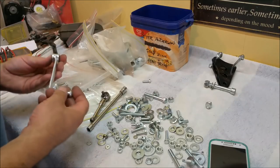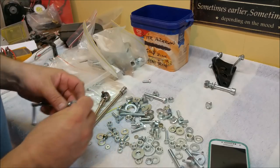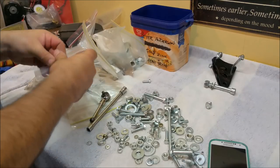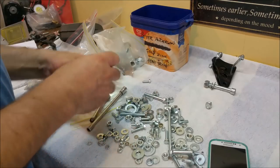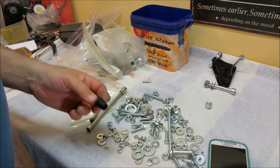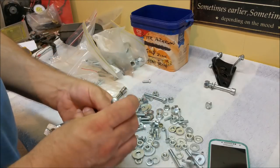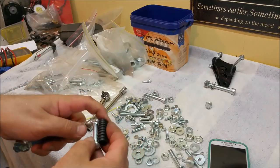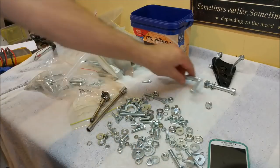The gear shift has been repaired in the past before we had it plated, and that looks about the right reach. I just need a lock washer. I also ordered this little guy here — I think it's the correct Honda gear shift lever boot. It's that sort of beehive type thing. We can just get a bit of slip and slide that over — perhaps a bit of rubber grease to get it over, and it's about the right length. It didn't say it was for an XL; it said it was for an ATV or something. But we'll put that on — at least the gear shift will look good.